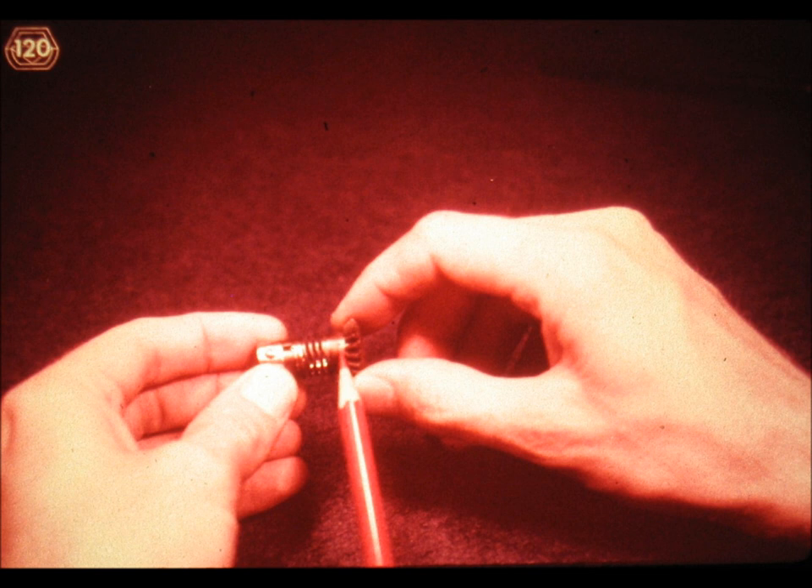This means that we have to install the pinion and the arbor in such a way as to allow for absolutely the minimum play between them, for the sake of the spring. We do this by adjusting the position of the collar, which is placed to the right of the tabulation pinion. From our observations, we conclude that the tab governor clutch will close if the tabulation pinion turns top to the front, while the hub or collar arbor remains stationary. The tabulation pinion gear, through friction, will drag the right end of the spring, and thus attempt to close it around the pinion gear arbor.